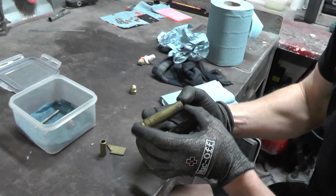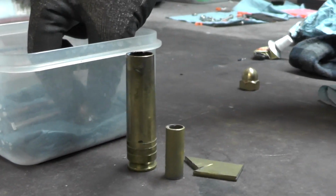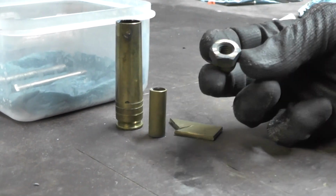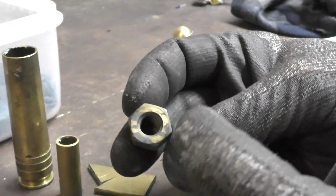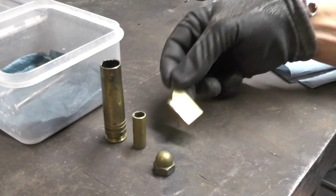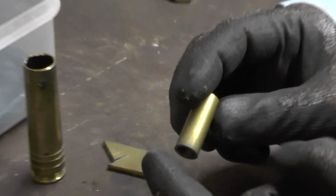The shell has tarnished. You can see the marks on there. And that's tarnished quite well. You see on the bottom, this is because I sat it on the actual material itself. So because I put it on the blue roll with ammonia in, you get these marks. So if you don't want those marks, you need to suspend it so you don't get the marks underneath it. Again, you can see this one around the bottom.